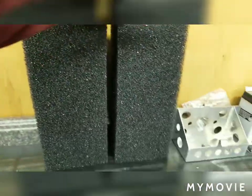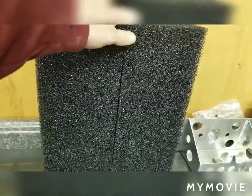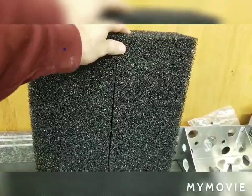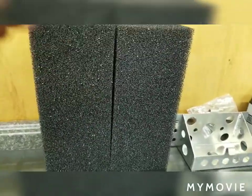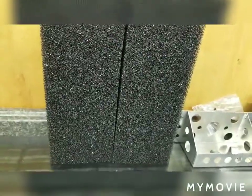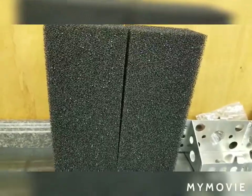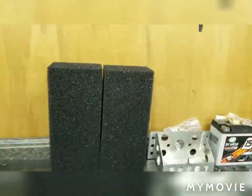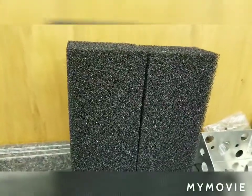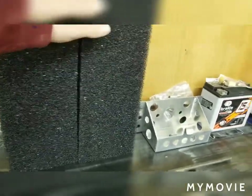Fuel tank foam. We're putting fuel tank foam in the tank to where when we get down to about 3 gallons of fuel left, I believe if we put this on both sides of the pickup, it'll help keep down on the fuel slosh to where we don't have so much of that breakup, because we have to run for 2 hours, and at about an hour and 45 to an hour and 49 minutes, depending on how many yellow flags, we start to get fuel slosh and the engine starts to miss, and we have to back off of our lap times. So hopefully with this thrown into the fuel tank, it'll help.